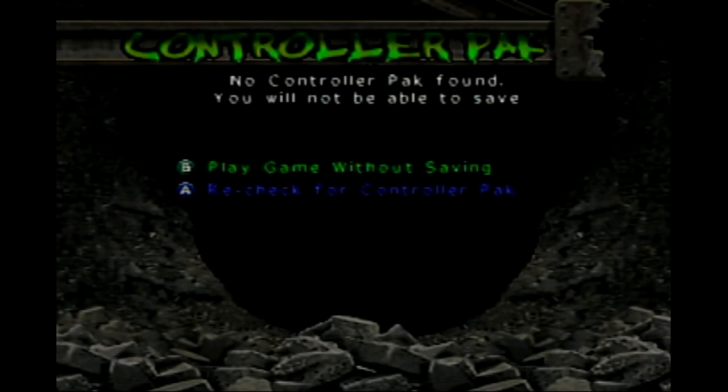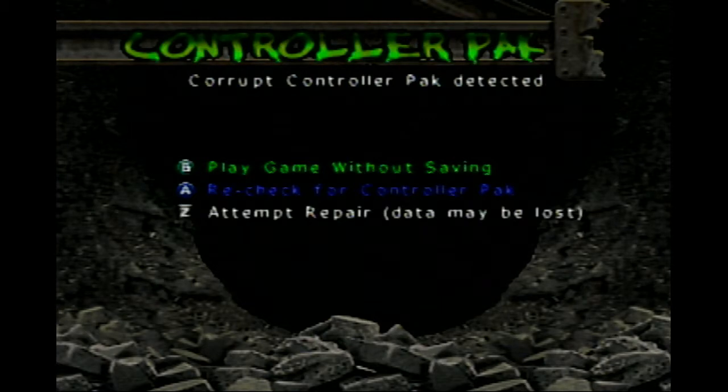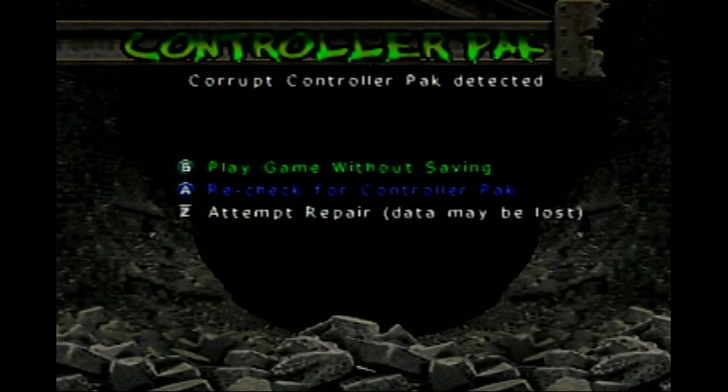Initially, this didn't actually work. It took me a few seconds of brainstorming, but I realized that what I really needed to do also was to clean the pins on the memory cards themselves. This is exactly the same as cleaning the pins on any sort of cartridge or cartridge-based video game. Scrubbing down the pins with a Q-tip that's doused in rubbing alcohol cleared it right up.